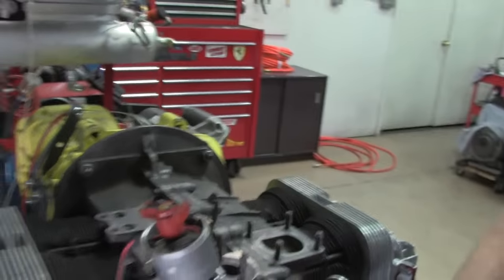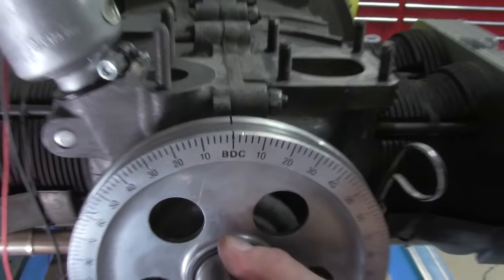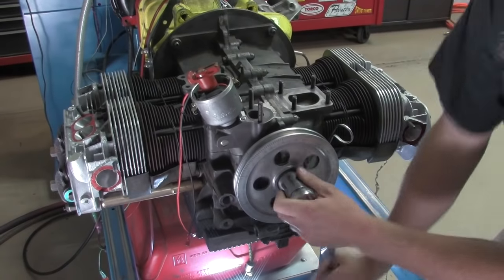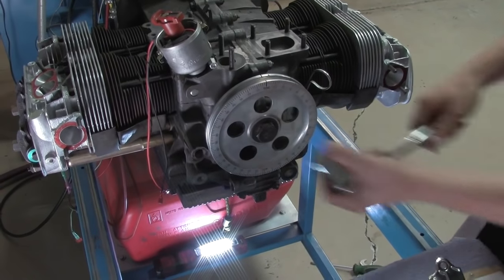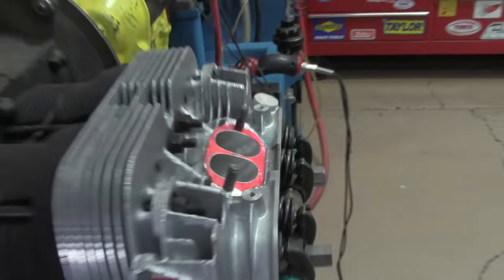If you go over to number one, you're going to find tight valves — the intake doesn't move, the exhaust doesn't move, and you can't spin the push rod. The cam is beginning to open that valve. So we're going to start with number one, go over 180 degrees — that will be bottom dead center. Our firing order is one, four, three, two. Bring it another 180 degrees and you should be top dead center number one with loose valves. Note: on engines run a long time without maintenance or with bad valve seats, you can have tight valves all around, so you may need to do a valve adjustment prior to these tests.